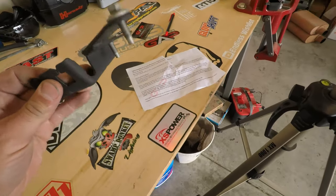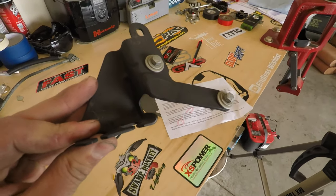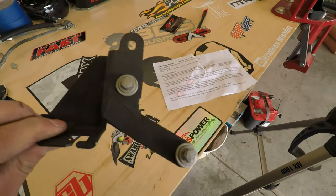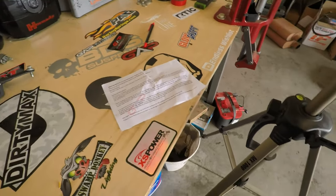We're back home. Will the old bracket work? Sure, why not — but if you ever have to adjust anything, you're pretty much stuck with what you have, unless you want to try and elongate the holes. Which, if you're not a good fabricator in the first place like myself, then you're kind of screwed. So for me, it is just a one and done. You don't have to ever worry about it again. If you ever change throttle bodies — because these aren't factory throttle bodies; mine is Holley, there's Willy's, there's tons of different throttle bodies for these swaps that are cable driven — because they're all different brands, they can have different tolerances, different slack or adjustment in the cable. So this would be the best option. If you ever switch between them, or the cable wears out and has more slack in it, all you have to do is loosen those bolts up a little bit, slide it back, tighten it back down, and you're good to go.